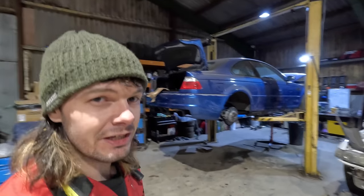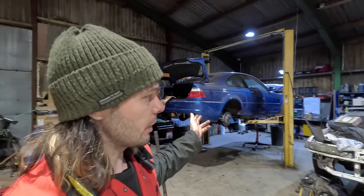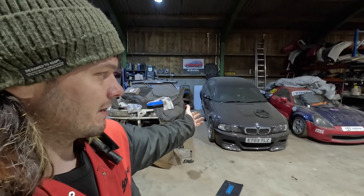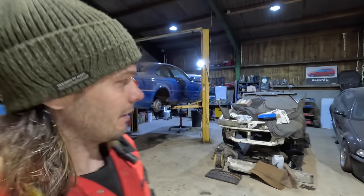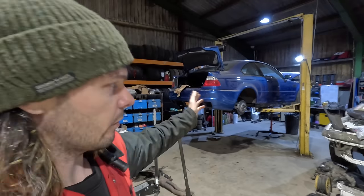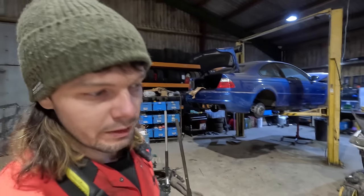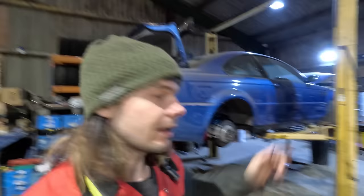Because I've actually got a rebuild kit from some friends from Eastern Europe called Racing Diffs. The plan was to rebuild the 3.9 before I put it in here, but I don't think we need to. Now the 4.1, I'll probably go back in this. I might fit the 3.6, I haven't decided yet, but 4.1's a nice sporty diff. The 3.9 should be just a little bit better for the Nürburgring, for the Nordschleife, right? So then we're going to try all that, but I think I'm going to get away with not having to do that little rebuild. I bought all the parts, but I think we're going to get away with not having to do it. Let's go over to the workbench.